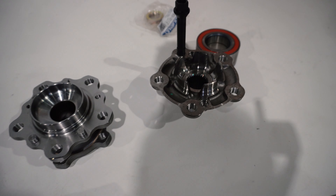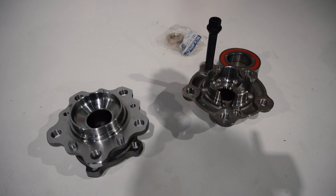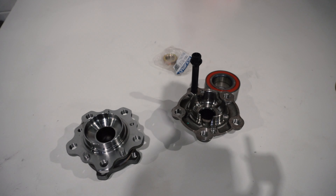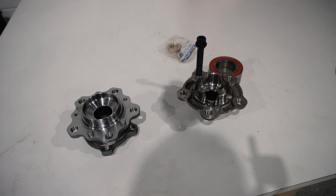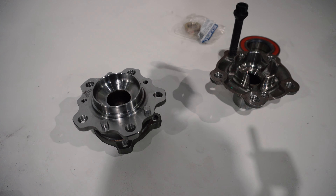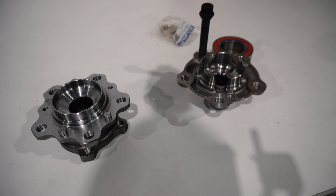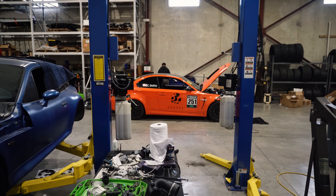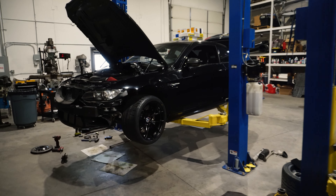Put your caps back on - now time to go back in the car. Good morning guys, it's the next day. We just purged the canisters and got those back in the car. Those quick disconnects are not easy - it took both Mike and I, even after purging them, to push them together. I don't really know how they expect you to do this at the track, so just never undo your canisters. We got a nitrogen tank and they recommended 170 PSI.